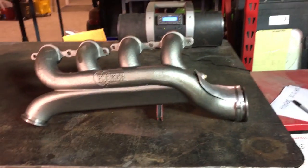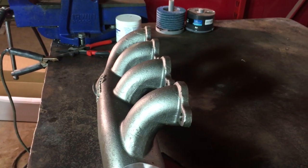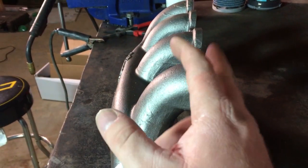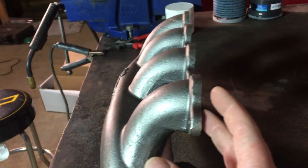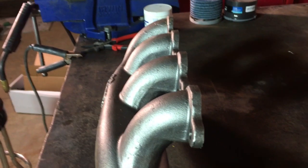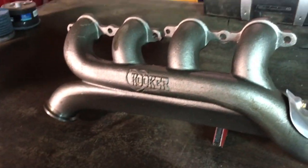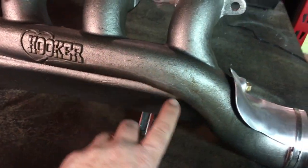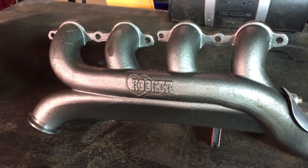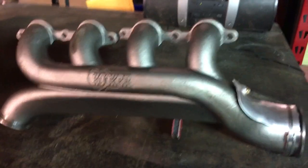There are a couple of reasons I wanted this manifold. If you followed my earlier videos, you know I built a homemade log manifold, but the problem is when I welded the collector flange I didn't have it bolted to anything, so the heat from finish welding warped the flange, causing exhaust leaks. I also don't really like the sound of my homemade manifold. I think this Hooker unit will sound better because it's divided all the way through. For now I've just bought the passenger side — I'll save up a couple more weeks and then buy the driver side manifold and the crossover pipe.